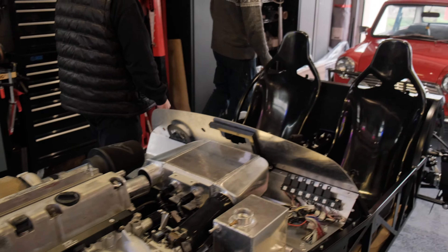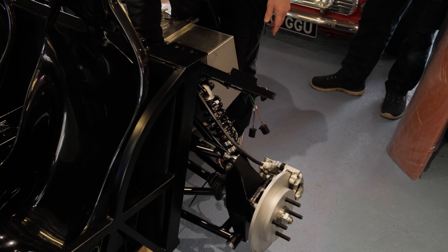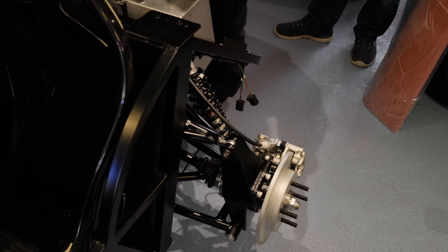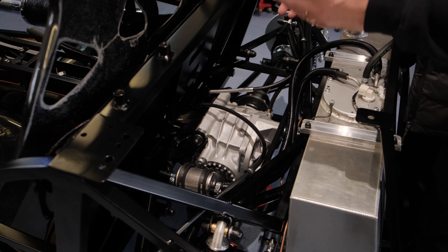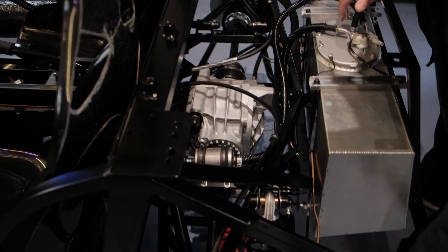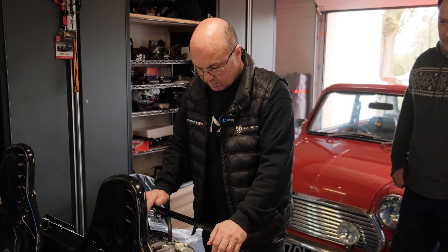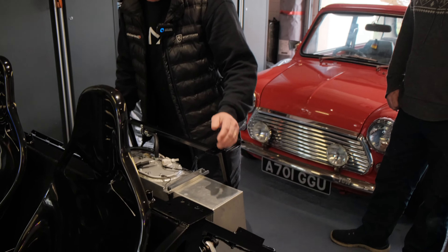Lots of fabrication bits - we've got sandwich plates in here for oil coolers. The radiator here is going to be for the charge cooler, because we're going to be using a cup-style nose cone. A much larger radiator - this is actually a standard radiator plus, so it's a 70mm core plus a 100mm, a much bigger radiator on this one. We've got the Protex shocks and the 2.2 quick rack. It's gone with a Sierra front upright, which is how we always do the Indy RR - Ben has done a fantastic job cleaning and detailing it. It's going to have a midi light caliper.